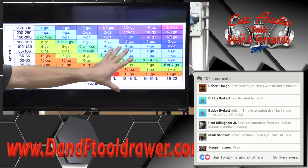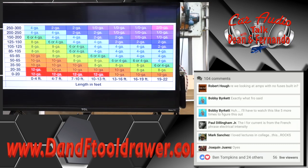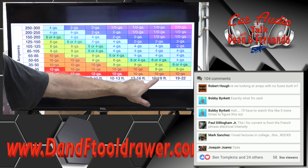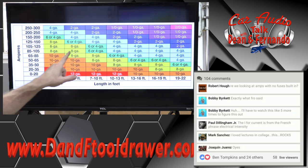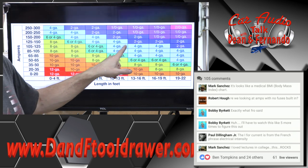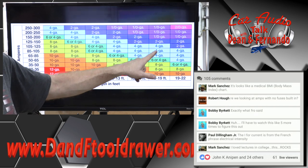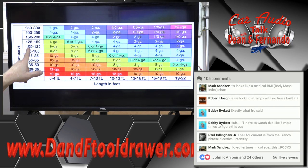This chart I found on kicker.com under their tech support — I tell you guys all the time, that's where you need to go. Now why this is important is most kits are right here. When you buy a power wire kit they're between 16 to 19 feet. Most power wire kits for 4-gauge come with a 120-amp fuse — this is why. At 16 feet, 4-gauge maximum is 105 to 125 amps.